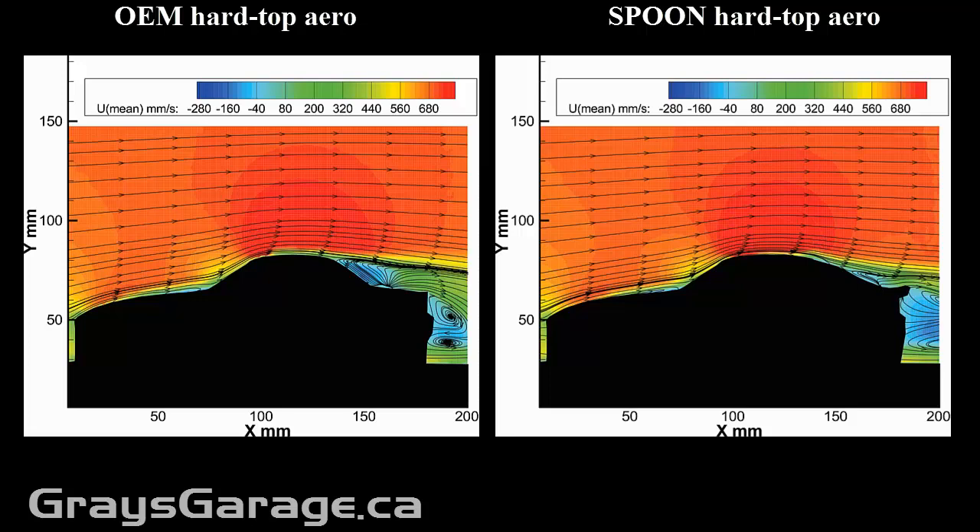You don't see fully separated or fully attached — you see a combination of the two. And the end result is a picture like this where you have the two flow structures at the rear end by the rear taillights, but you also have a sort of third interesting pseudo-structure along the rear windshield and rear trunk.